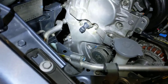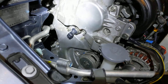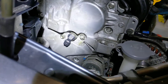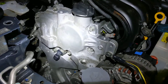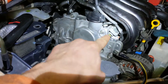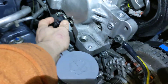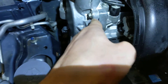One thing you should be aware of is the VVT solenoid, which is over there. If you are doing a head gasket job or need to remove the timing cover, do not attempt to pull it out. Only unscrew it from inside — it has an eight-millimeter screw. Untie that, loosen all the other bolts, and remove the cover. As you're removing the cover, spin the solenoid so it's out of the way and inside, then start opening the cover.